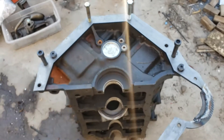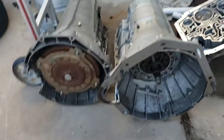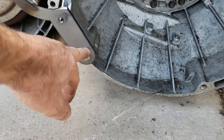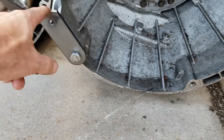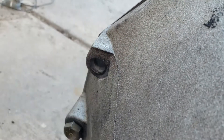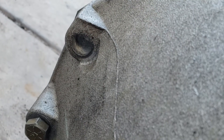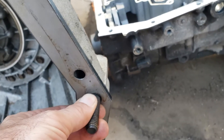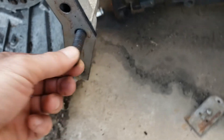So then I'll show you what that looks like on the transmission side. So now we're over here on the transmission side. You have this 10mm by 1 — I believe that's what this is — which kind of anchors the bottom where the starter is going to go. So your dowel pin, and dowel pin. I took the transmission and just ran a half-inch drill bit through the factory transmission hole there, because I think it's really like 11mm or some odd size. So you need to neck it up to get that to slide through there, and that's about how much thread you'll have sticking out into the motor.